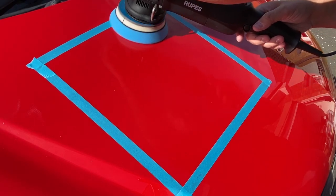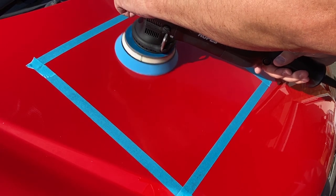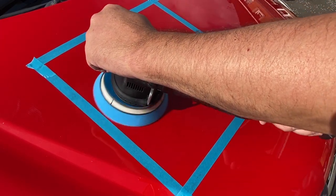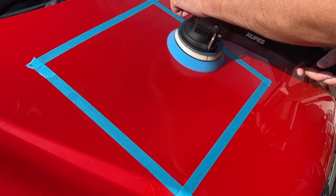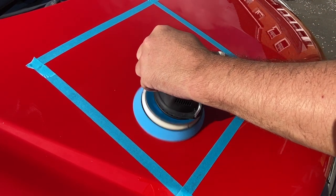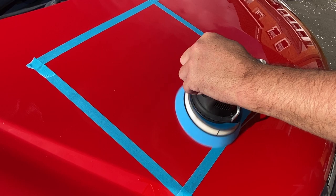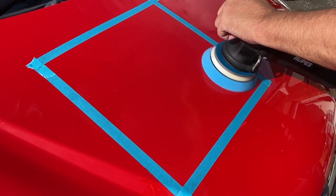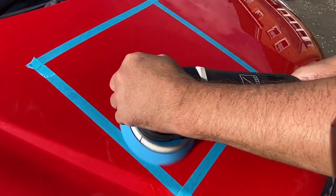The overlap should be roughly half the size of the pad you're using, and it's important that you keep the polisher level with the panel. You can tell this by marking a line on the backing plate - if it's not turning, the polisher isn't level and not doing its job. The other function of a dual action polisher is the oscillating feature - that's the pad wobble you can see. I recently saw an Amazon review of a basic polisher where someone was complaining the pad was wobbling - that's the difference between a dual action polisher and a rotary. Now I'm going to quickly speed through the set to see the results.